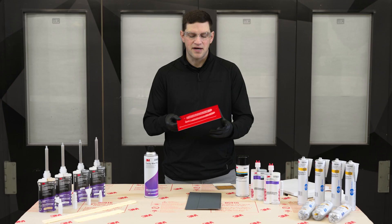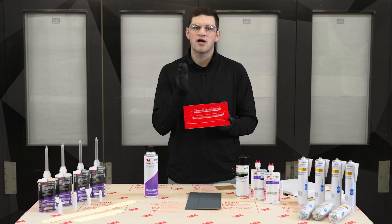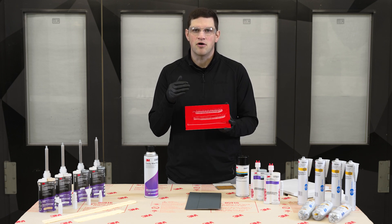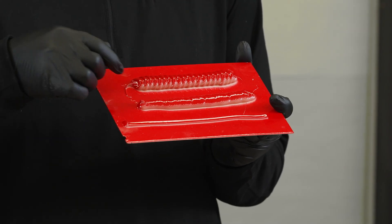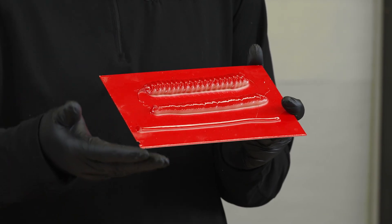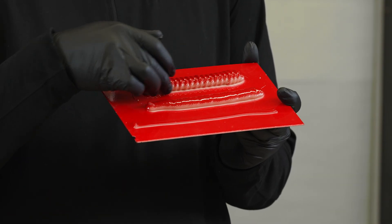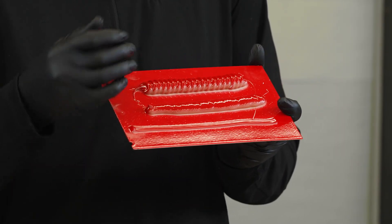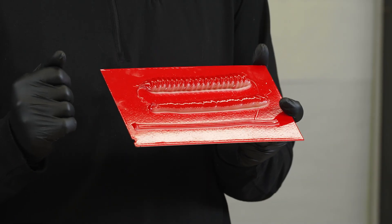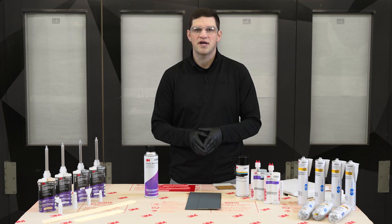Another troubleshooting aspect: what epoxy primer does is give us that base corrosion protection before we go to any other steps of applying seam sealer or top coats. In areas like our wheel arch, one common situation we see is the shadowing effect — we don't completely get the paint gun in there to get good coverage over that bead. In instances where we use epoxy primer, we'll have that protection. If we don't and we apply bare metal, this repair is going to rust or corrode almost immediately when it hits the streets. So make sure you're taking due diligence, following OEM recommendations, looking those things up, and doing the repair properly.